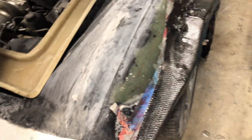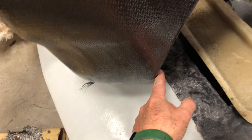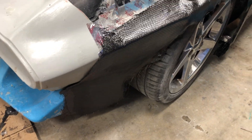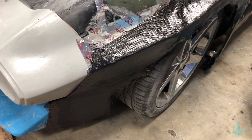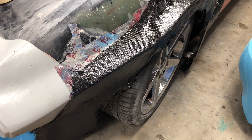The reason why I have to do all of that is the difference between the C6 and the C2. If you look at the C2, there's very little space in between the very front of the car and the opening of the wheel well. If you come over here and look, there is about nine inches extra, something like that — so I had to fill in that space in between.